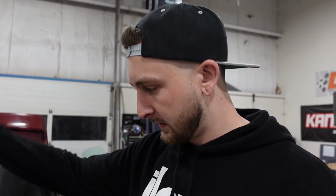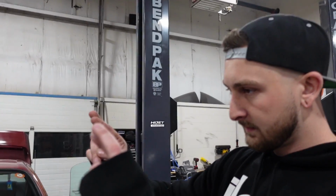The engine hasn't run in a really long time. We did crank it over for a while, but some oil needs to get up there high and get in there. So we're gonna run it for a little bit longer. Hope that quiet sound goes away. The head just isn't fully bled, hopefully, and the VTC gets oil through the head. So fingers crossed.